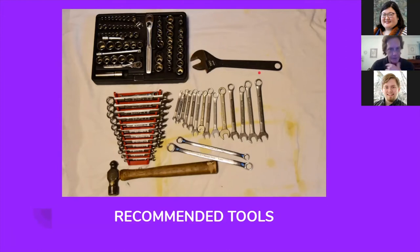If you're going to use an adjustable wrench, you want to use one like this. This particular one belonged to my dad — it's over 50 years old — and the thumb wheel spins very easily. The movable jaw does not wobble back and forth at all. Nice flat jaws and it works very well. One thing you want to be careful of: if you're using an adjustable wrench, grab the lower jaw. If you can move it up and down, throw that thing out — it's going to damage nuts and bolts that you try to use it on.